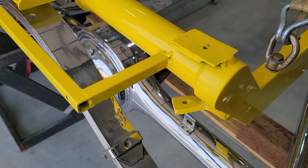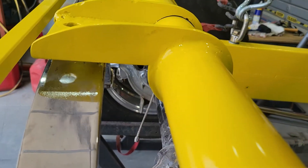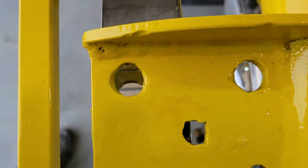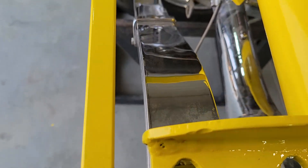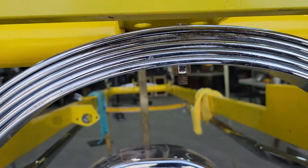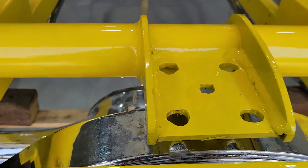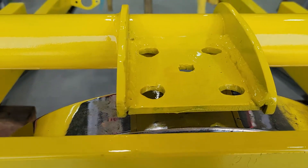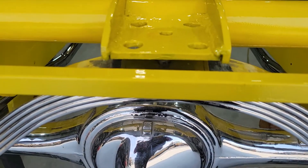That's just the first impression. Yep, just what I thought. As you can see, that spring jumped about an inch or so back, so it doesn't line up for the U-bolts. I need the distance of my radius rods the way they are. So what I'm going to have to do is build a plate that goes between the spring and the mount that's offset. I'll tap some holes in the plate and bolt it in from the top.